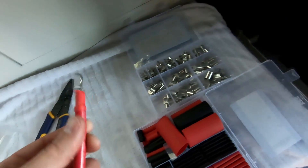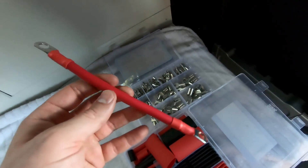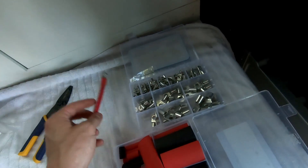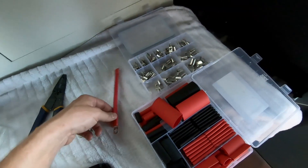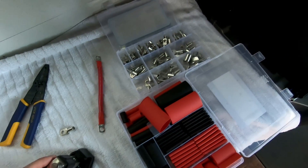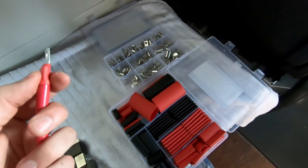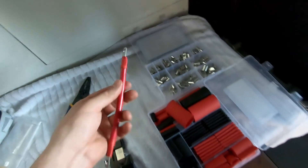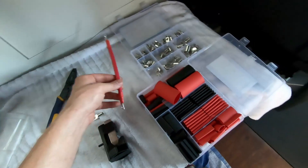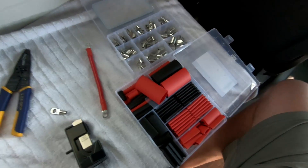Make sure to get the heat shrink to the same diameter as the wire you're buying. You can buy these things pre-cut and pre-crimped, but in order to do that you need to know the dimensions and how long for them to cut it. I didn't know that going in, so I just bought a spool and did it myself on the fly — it worked out pretty well. This wire spool is about 25 bucks; I'll put a link in the description. To heat shrink I used a little butane heat gun, but you could also use a hair dryer or a lighter. I highly recommend doing it yourself unless you already know all the exact distances. So yeah, let's get on to the 12 volt fuse box — we have it installed right here, also behind a 100 amp fuse at the bottom.